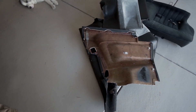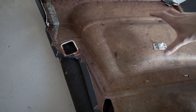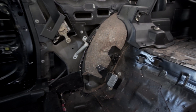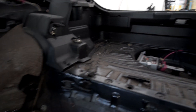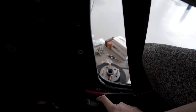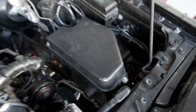Removing the rear quarter trim panels — once I drop these panels to the upholsterers, they can lift up the tabs, break the panel apart, separate out the middle section, and get behind the fabric to glue it down. This is what the inside of the car looks like now with the trim panels removed. Whoever did the swap on this car previously did a pretty good job — the battery is relocated to the rear. They ran the ground cable through the door sills and fender well, and the positive battery cable ran through the driver's side. The battery had to be relocated because it originally sits where the ECU box now sits after the beam swap.